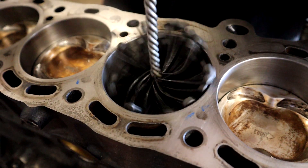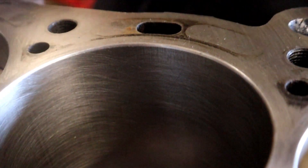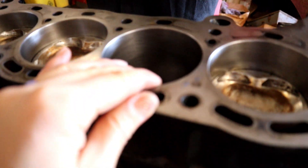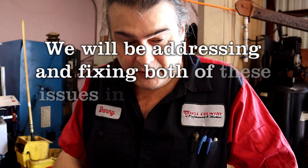I find it easier to just grab this and slow it down. All we're doing is just getting rid of the little bit of glaze that had started — beautiful. It's going to just help promote ring seal. It doesn't have that many miles on this motor. The fact that it was glazed so much was kind of scary, honestly — it was an oil pumper, just pumping a lot of oil. We found out where that was coming from too: the ventilation system and the turbo was a little bit on the loose side.